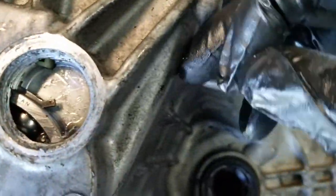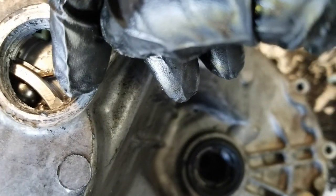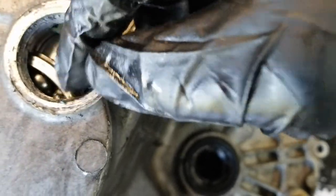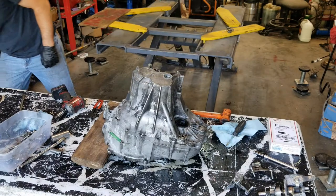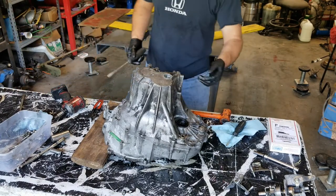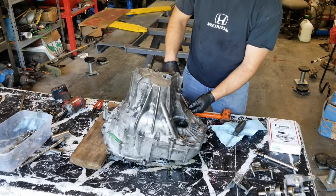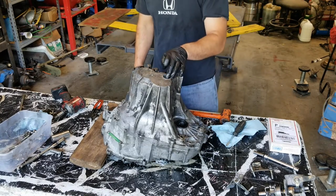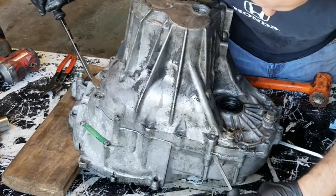The next thing we've got to do is separate and get our snap ring to where it's not in the bearing. If you look here, you can see the snap ring — it's got an ear right over here and an ear right there. So we've got to separate them and then this bearing should drop down. I'm going to start splitting the case so that the gear stack will go down and we can get this snap ring out. You can see there's a little bit of a gap here now.